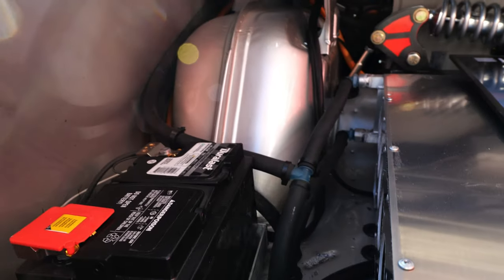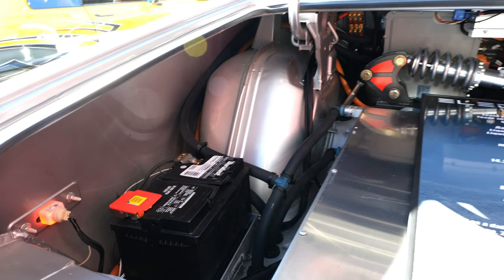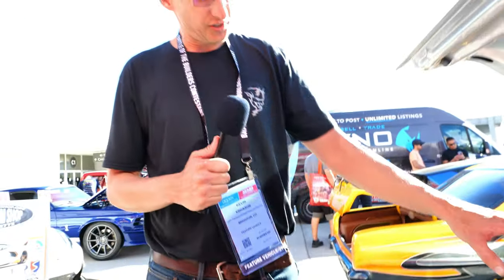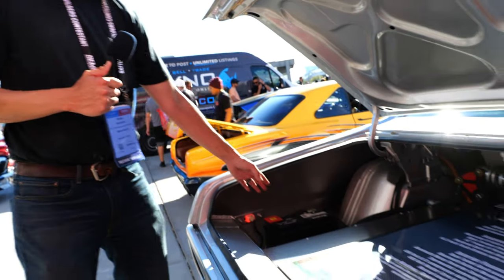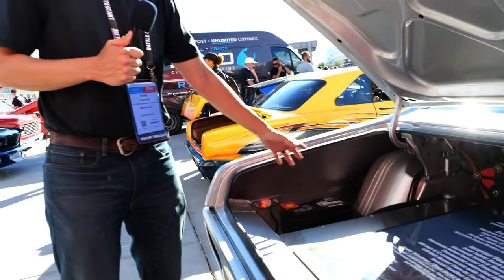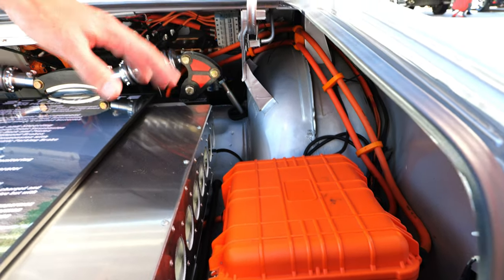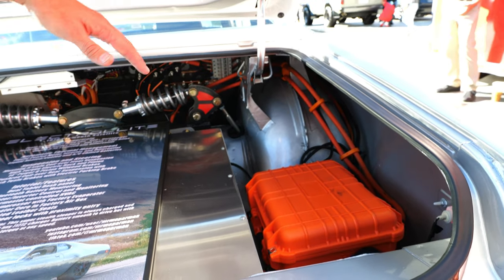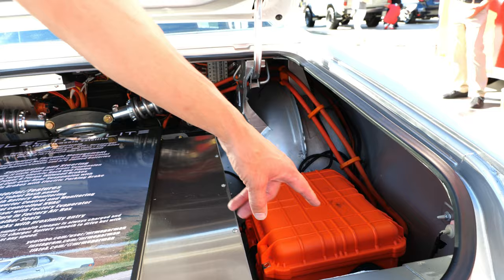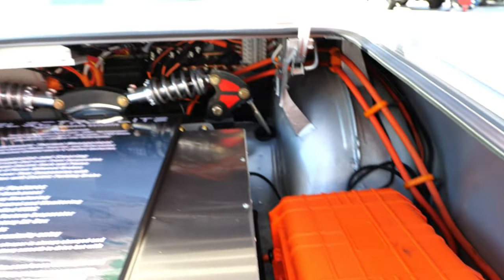Something a lot of people don't realize: I still need a 12-volt battery. It's still got a lead-acid battery because all car functions, even the computers, run off 12 volts. But the charger has a DC-DC converter built in — it takes 400 volts from the battery pack and charges it just like an alternator would, so right now the battery is sitting at about 13.8 volts. Inside this orange-labeled box are the high-voltage contactors, high-voltage bus bars, and a service switch so I can disconnect the high voltage, with an external cutoff accessible at the track.